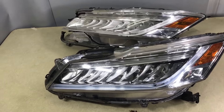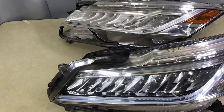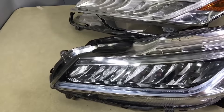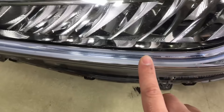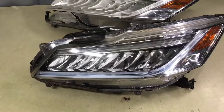In this video I have a 2017 Honda Accord headlight. These specific headlights are full LED — high and low beam. The problem with this headlight is the daytime running light; the bottom part has a severed LED which burned out. This is a very common problem with the Honda Accord.